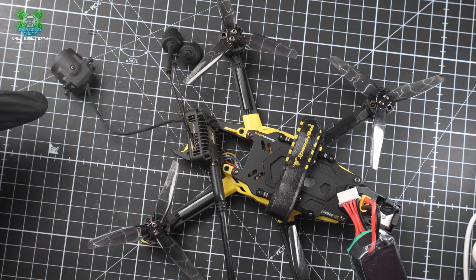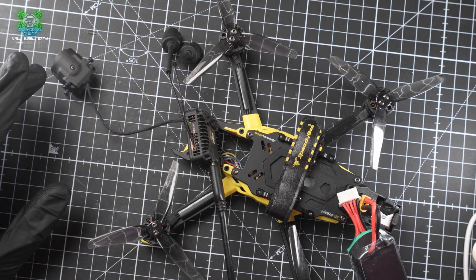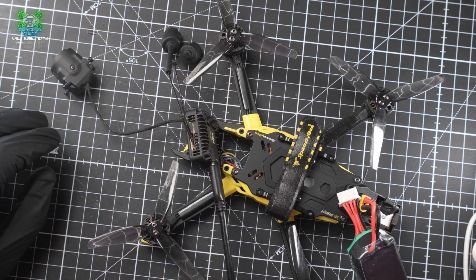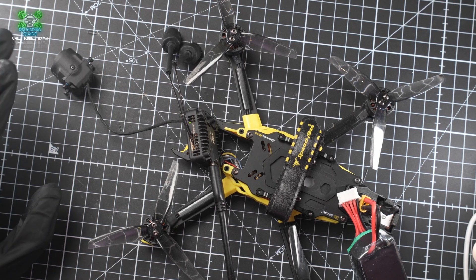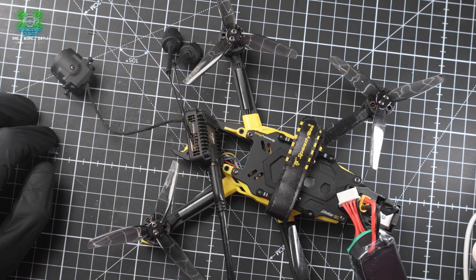Just confirm your account and it's done - it's activated. But there is still another step you need to do with your goggles. You're going to need a USB-C to USB-C cable because you'll have to plug the goggles into your phone to do the final part of the activation inside DJI Fly. It's a bit of a pain, but we've done everything we need to do on the PC. We'll grab the goggles and finish off the rest.